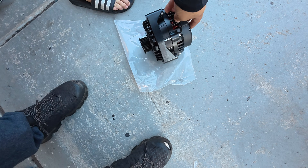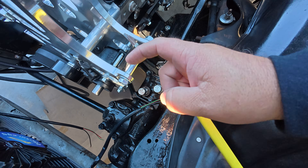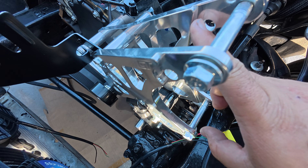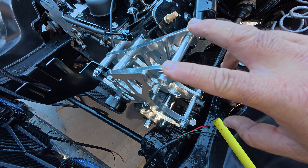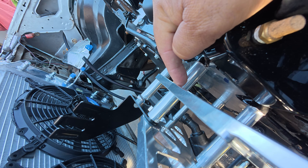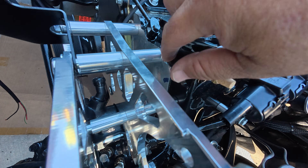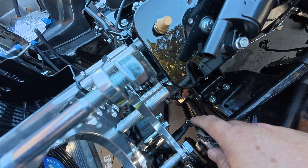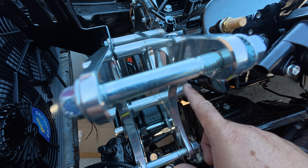The mounting point for that alternator is going to touch here, here, and here. You want to make sure those areas are not powder coated or painted. You can tape off this section, or if it's a smaller alternator you can use the bolts — tape off this whole section so the alternator makes good metal-to-metal contact. Now the bracket is looking for ground too: the area where it mounts to the block — that lip must not be painted, and the block surface must not be painted. The more spots your alternator has for ground the better, especially with a high-amp alternator like our 220-amp unit.